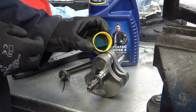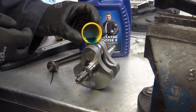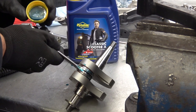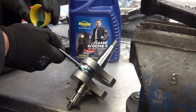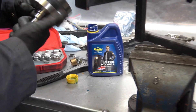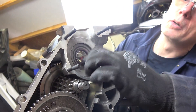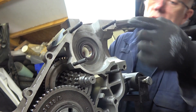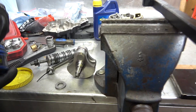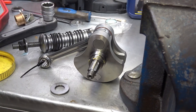First things first, I'm going to do the big end so it doesn't start dry. And the same with the small end — we're going to rebuild that anyway, but it's a good idea to get it all lubed. I'm going to put a little bit of oil on the oil seal, just so that's not a dry face, to help on start up — just greasing up that shaft a little bit to help its entry into the bearing and the edge for the seal as well.